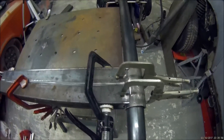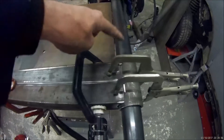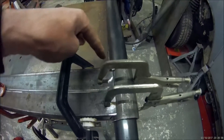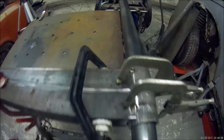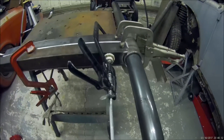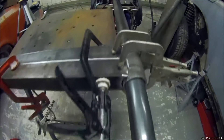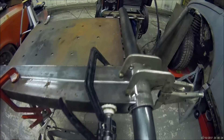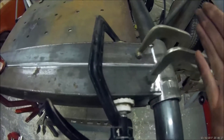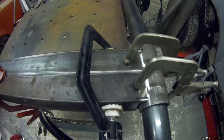I'm purely eyeballing this now, but the table is square so I've set these tubes up with the edge of the table. That pivot tube is running along that edge of the table — it actually looks like it's pointing away in its natural resting position. If I then put weight on this tube just with my finger, you should be able to see that it's now parallel. So this angle I've got here, with this sitting back, is going to allow for the slacking of that tube so the engine sits square when the weight's on it.